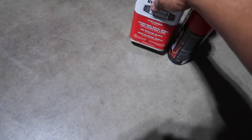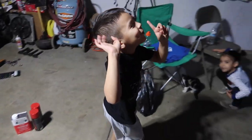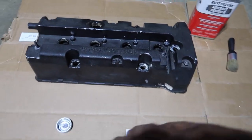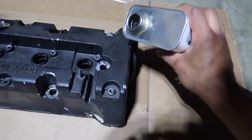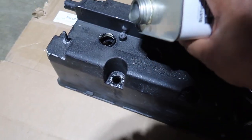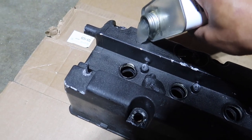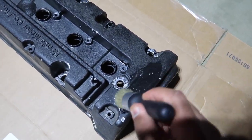Pulling up on both sides and the valve cover is off. We're using the aircraft remover from Rust-Oleum, going to spread that on after we degrease it and find some cardboard. Set up with cardboard, valve cover ready, opened up the bottle of aircraft remover. Dumping a little bit on — look how thick that is — spreading it around all over the surface.